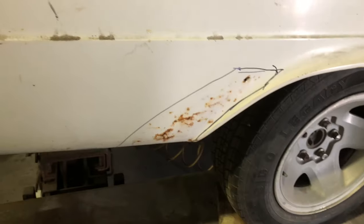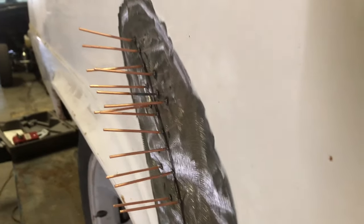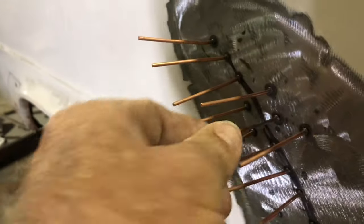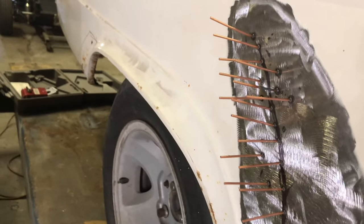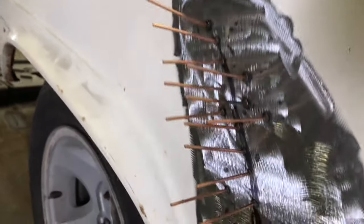Here's that panel with the dent in it — it's all been pulled out. I welded the pins onto it and it gave me a good pull. Most of it's all out where it should be. There's some slight oil can — just very slight. Once I take these off, I'm going to run my shrinking disc up there and give it a couple of shrinks, then cool it down real quick. I'm pretty sure this line here is a little bit proud in the middle, and that'll pull it all back in and it should be flat. Then I'll put my first fill over the quarter panel there — always go way bigger than the repair area, then sand it down so it's smooth.